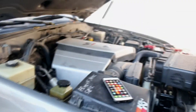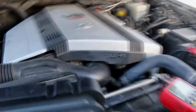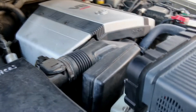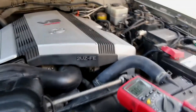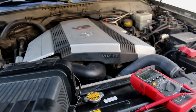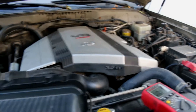Pop all those bolts out, pry the valve cover off, take this plastic shroud off, then take the valve covers off and clean off the old gasket and install the new one. Valve cover gaskets are known to leak oil a lot on these, so don't be surprised if you see oil leaking from around the valve cover. If you're buying one of these cars, that's pretty typical — not a big deal as long as you're not burning oil.